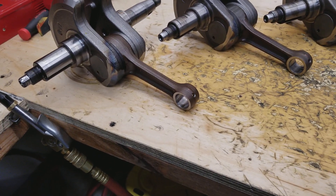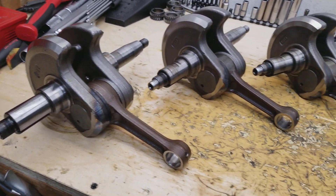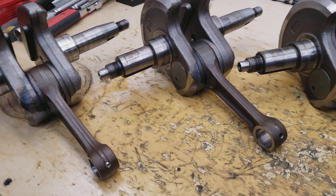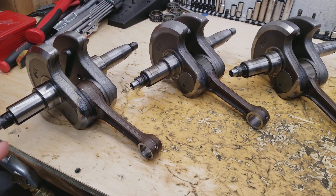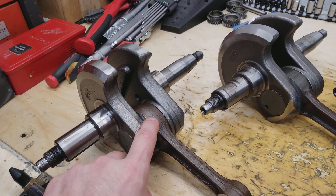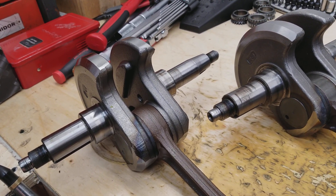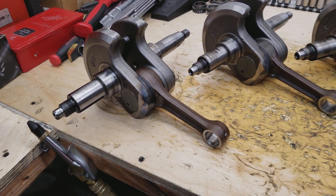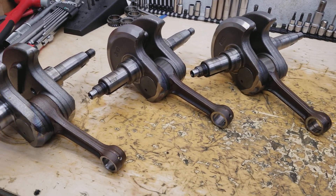I wish they would improve the wrist pin issue, but to me it looks all about production costs — and ultimately that's what keeps the price down on the bike and on maintenance. If you're replacing the crank, I'd say get the 2015 and double-check the clearance between the rear counterweight. There is a little bit of weight difference on each of these rods — this rod is going to be heavier, about 20 grams — but it's pretty close to center and I haven't seen vibration issues from guys making that swap. That's what we've got — we'll see you again, thanks.